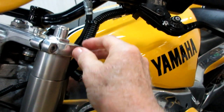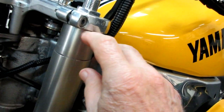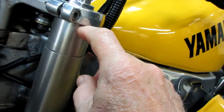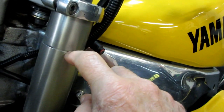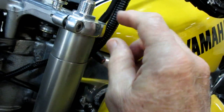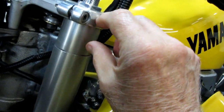This is our FZR. When I did a 900-hour restoration — all the videos are on the channel — it looks like Yamaha is probably thinking you could lower that a lot. I made lowering links for this bike and lowered the back. The next time we start riding it again, I'm going to try lowering the forks a little bit more. But it looks like Yamaha is already telling you that's as low as you should go. Keep in mind this bike originally had clip-ons, so that recess may be for the clip-ons, but it's also the diameter the clamp tightens on — you'd want to stay in that range.